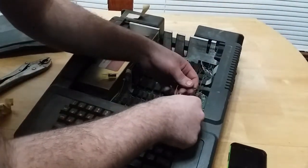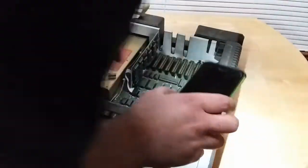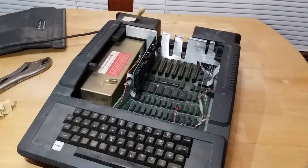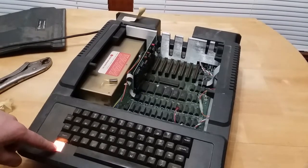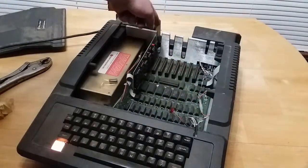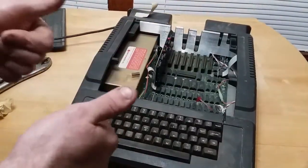Oh, so what happens if I was to undo this and plug you in right there? Okay, so the speaker is still not working, but now the power light's working. Okay, so that's interesting, and all I did was this harness here goes to this backpack unit here. And I just plugged the speaker wire directly back into the speaker port on the motherboard. So somehow that brought the power LED back working. So progress by unplugging something.